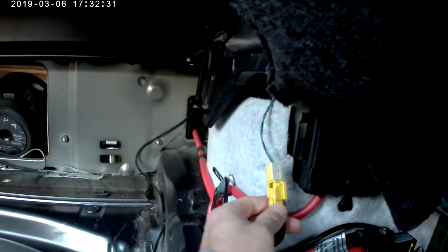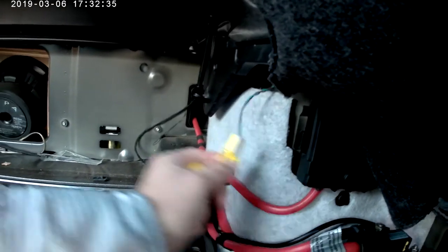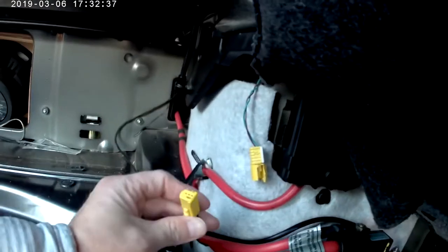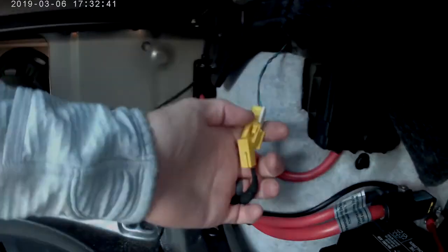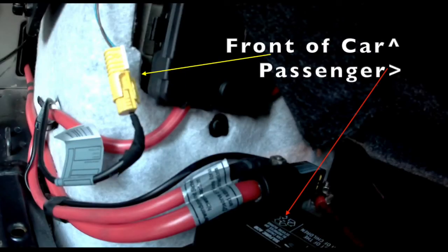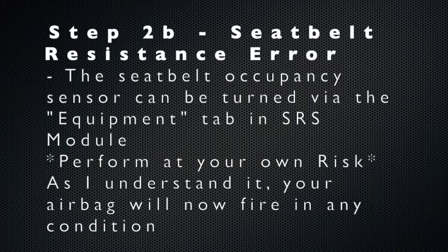Once you've removed all the panels, the battery safety terminal is this yellow clip and subsequent wire that I'm holding. Mine had come undone when I broke the clip changing the battery. You may have also smashed something else into it. Either way, check your battery safety terminal clip and the surrounding wires and fix whatever is needed by soldering or electrical taping, etc.